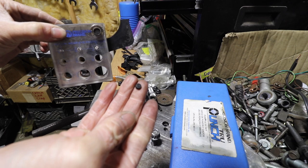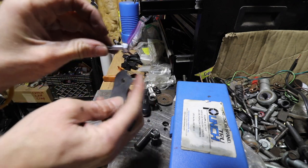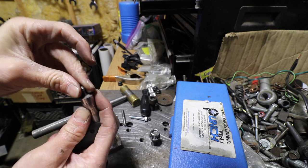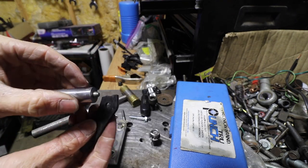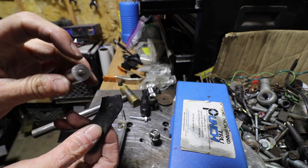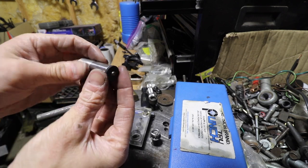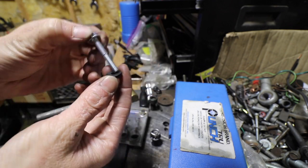You can see that's through now and I got the little end it punched out. So now I have a hole for the bolt to pass through — it passes through fine. But I need the outside to be a circle so it can fit under the bolt head. This is a 5/8 inch punch, which is the right size for the head of this bolt. On every single one of these punches there's a hole that accepts a little insert — this insert is a quarter inch — so when I put this piece of rubber into the die, this tip will center it perfectly and it'll be a round washer when it's all said and done. I tap on it, and right there it just went through. This is the little washer I just made with this punch set — absolutely perfect.